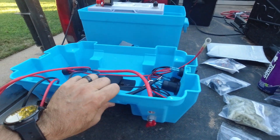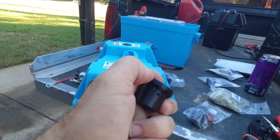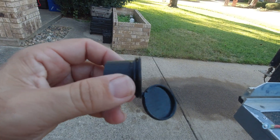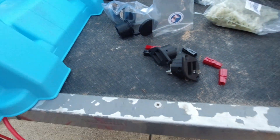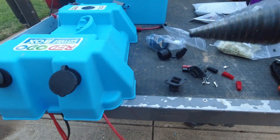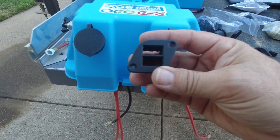I've added these power poles. I got these off eBay — they are 3D printed. I got one set that came with the power poles themselves and then four sets that were just blank. I was trying two or three different varieties to see which ones I like best. I also got these, which sit kind of flush mount — they're still round in the back so you'd still drill a round hole. I used my step-down bit on my drill to drill the two holes. You can do various sizes with that bit, so you can flush mount these.